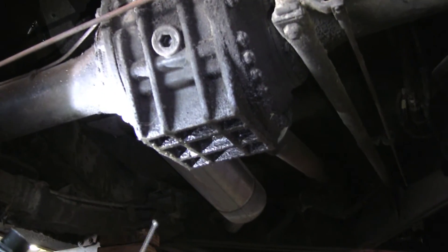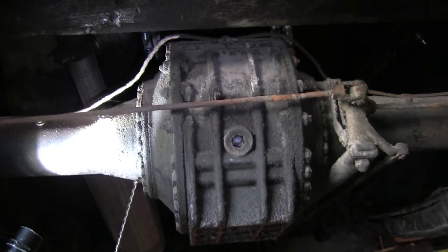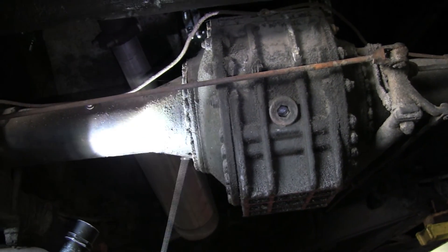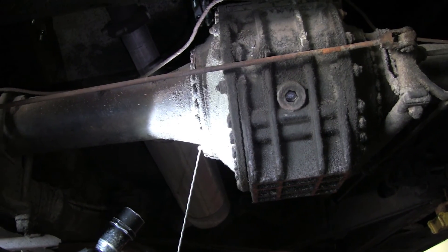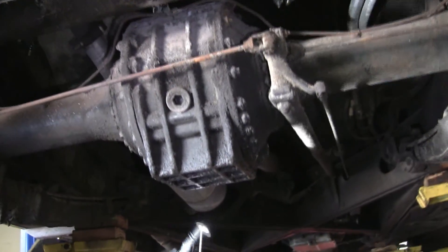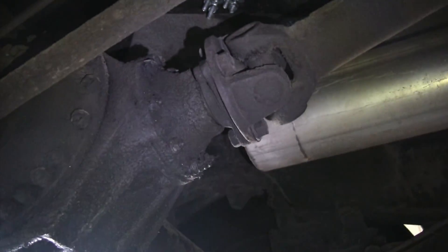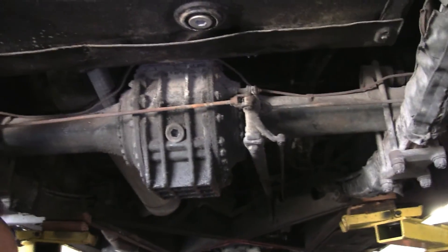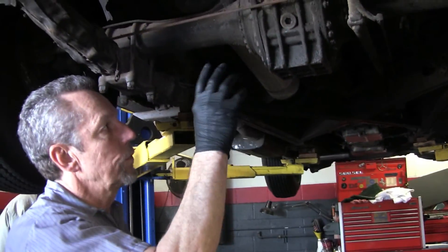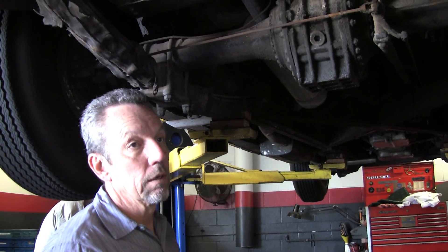Another common place is the differential. It has little weep holes on each side where a seal goes around the axle shaft and holds differential fluid in — those go bad quite often. When they're leaking badly, you'll see a trail of oil coming down. Also up front, there's a felt seal, and if you see fluid running down from there, that's a bad sign. The differential is pretty critical; it doesn't hold but a pint and a half, compared to the Silver Shadow which holds four-plus pints. If you run it low, you can burn it up — and that's a very expensive fix.